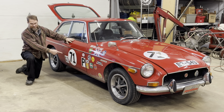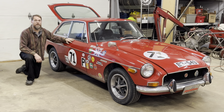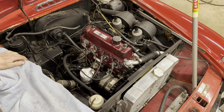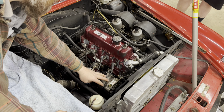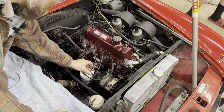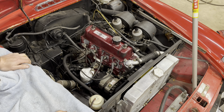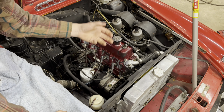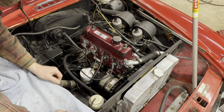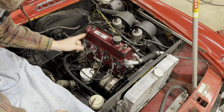The 71 MGB GT is back. This time we're putting an alternator on it. This car originally had the five-wire alternator in 1970. At some point in its history, a rebuilt three-wire alternator was put on it, but they never actually put the connector on it — they just stuck the wires on the terminals. We're putting a new three-wire alternator on it, since that's pretty much the only thing available as a new alternator these days, and we're going to put the proper connector on it.